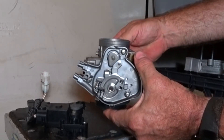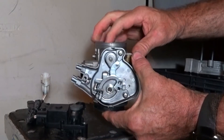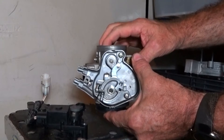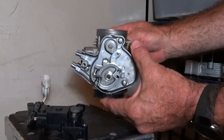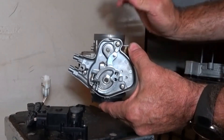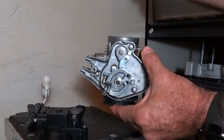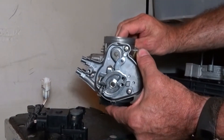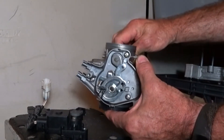You can see that moving this top shaft and the butterfly here has bearing on that bottom throttle. What it's doing is, by use of the motor, when the ECU senses that you're back into an idle condition — so your primary throttle is closed, your hand is off the throttle — the ECU then moves this top shaft around and maintains idle speed.